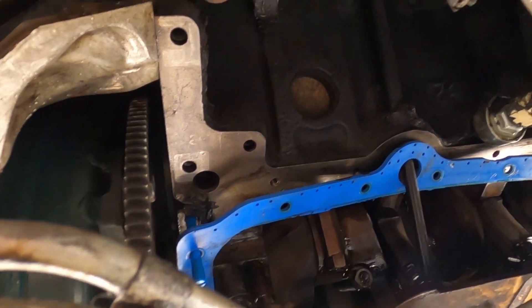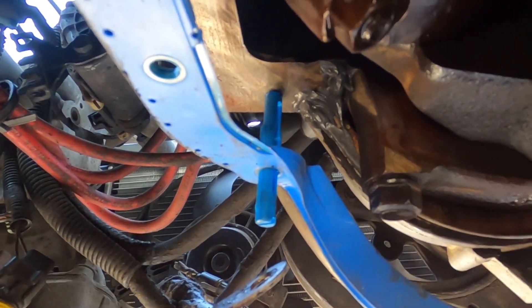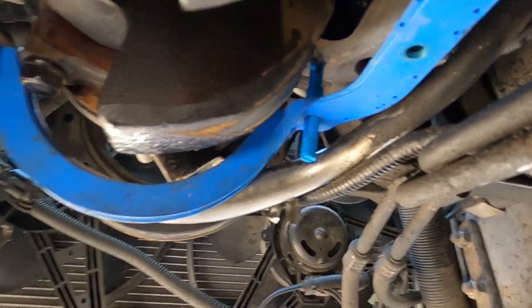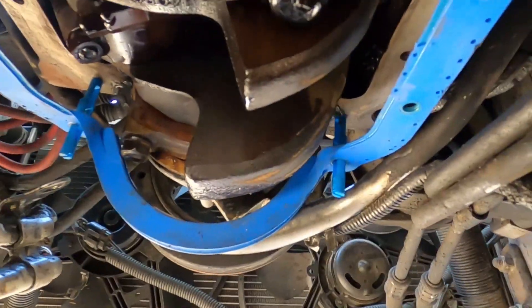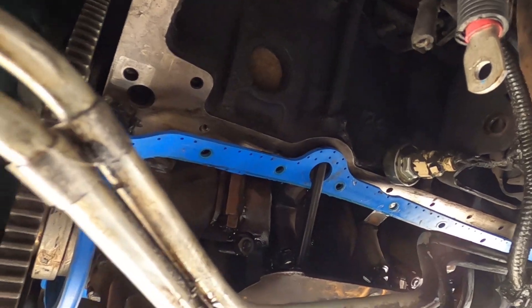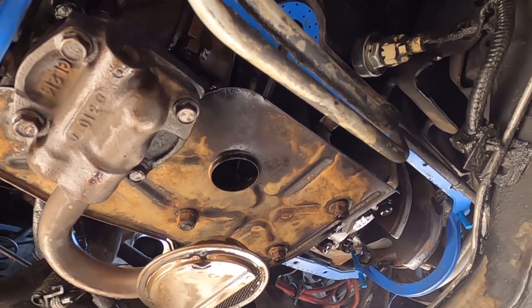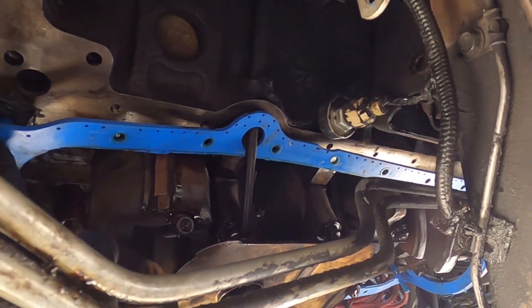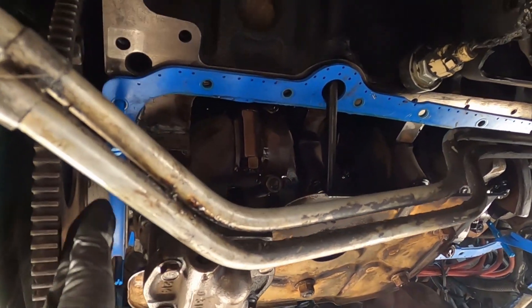Also, RTV — you're definitely going to want to use RTV. I'm using RTV Ultra Black in the four corners. Just use it in the four corners, right between where the engine and the rear and front main meet. Be very generous with the RTV — don't be afraid to give it a nice clump in there, because the last thing you want to do is leak and that's where they will leak. Be generous with the RTV, use it in all four corners. The mating surface should be nice and clean — I also used brake cleaner right before putting everything on.